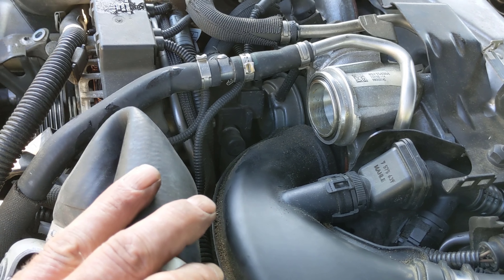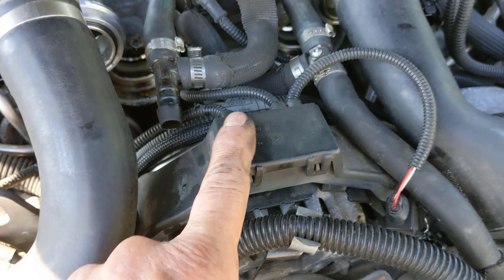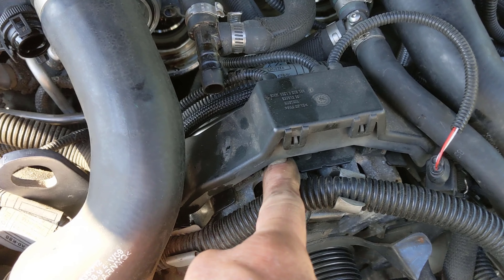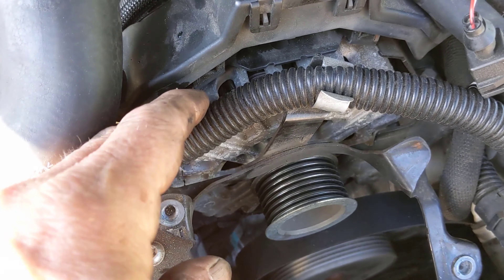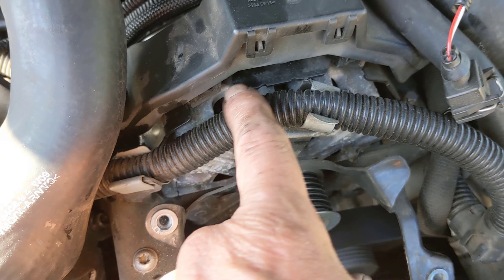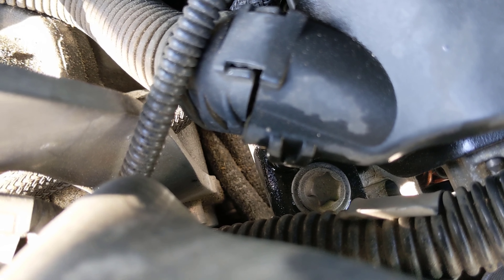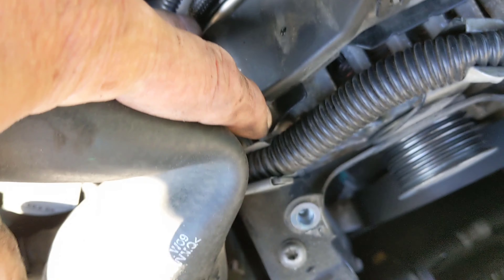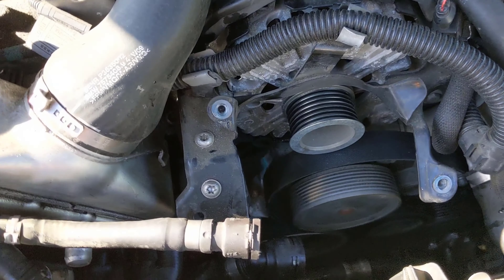Take your clamp loose on both sides, then with the intake ducts out of the way we can take the alternator loose. This piece is just clipped in — stick a small screwdriver in and pry a little bit and it will pop loose. There's a plug you need to unplug, and then take the tube out. Looking down in there you'll see four Torx bolts — two on each side — pull the hoses back out of the way and take those loose.